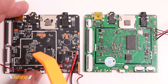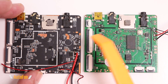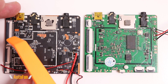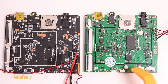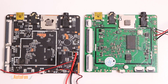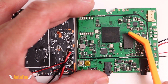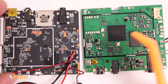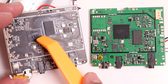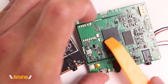Here is a side-by-side comparison of the Van Top H612T and the AutoWell V17 Pro boards. The footprint is overall about the same and the connector placement on top is very similar, but the actual board layout and components are different. The connectors on the V17 are in a different arrangement, and Van Top has additional connectors plus a small daughter board, which I suspect is for voice control functionality. Van Top is equipped with two gigabytes of memory on one side and an additional two gigabytes on the other — four gigabytes total — whereas the V17 Pro has only a single one gigabyte.